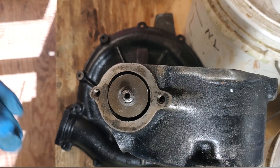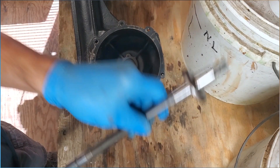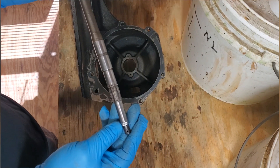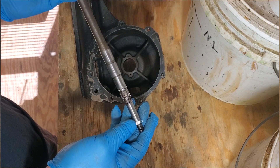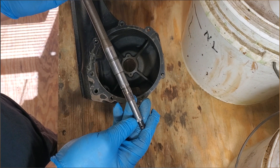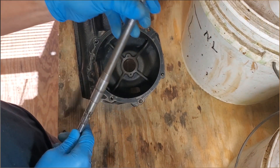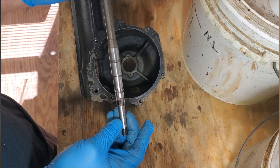Let's take a quick look at the supercharger shaft. This one had been done previously, but it's being redone because it was run about 100 miles with gasoline thinning the oil, damaging the Babbitt so badly we had to re-Babbitt it. The bottom was previously sleeved. The top, the middle, and the bottom have all been turned down, giving beautiful surfaces for the Babbitt to ride on.